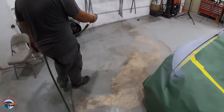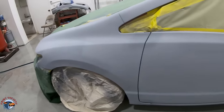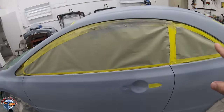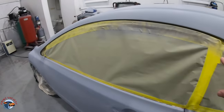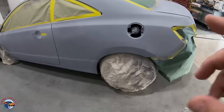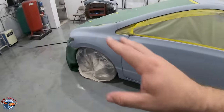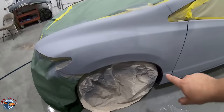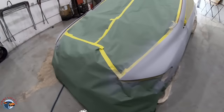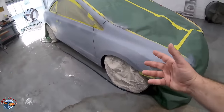Be mindful that water does create humidity, so that's another thing to think about — paper or wetting the floor, your choice. Now the key to a clean paint job whether in your booth or not is clean taping, and you can see there's not a whole lot of open crevices on the tape job. He did use paper. We are using wheel covers. Make sure you remove the inside fender liner so you don't get any overspray on that. It's your preference between paper or plastic — it doesn't matter.